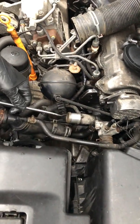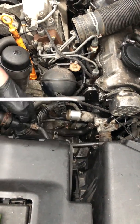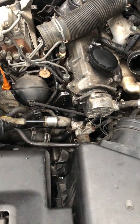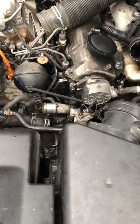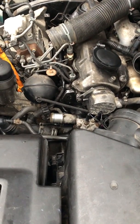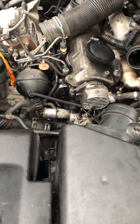I was able to get the rest of it — the guts of it — out by removing this hose, drained a couple liters of coolant, and poking a screwdriver in here. If you jiggle it around you can get to the right place and tap it, and that knocked the old sensor out. So now I'm just going to hook it up and with luck this will cure the problem. I hope that's useful, bye.